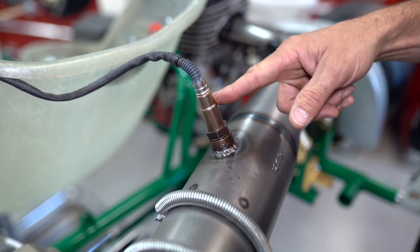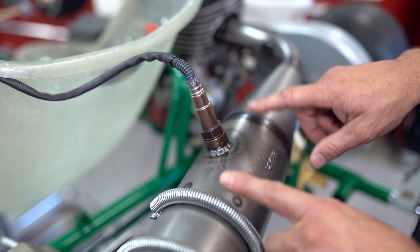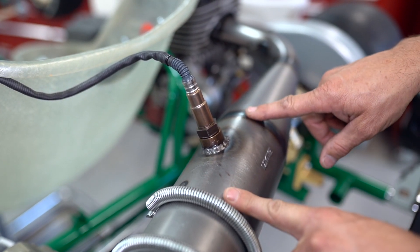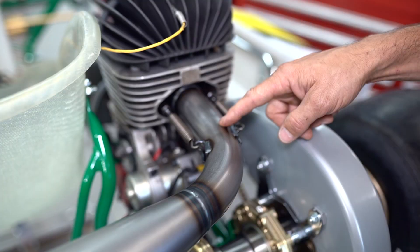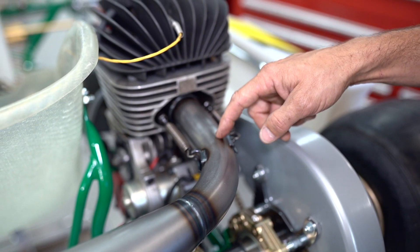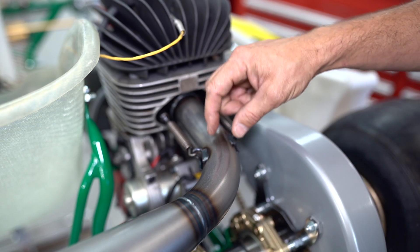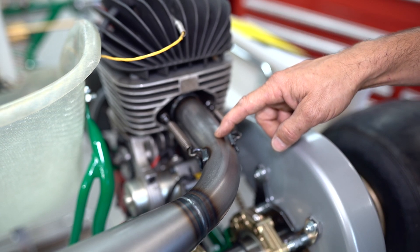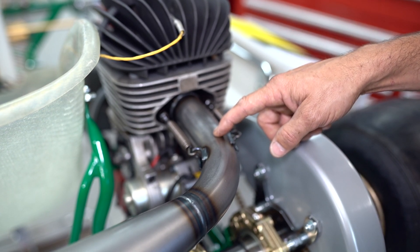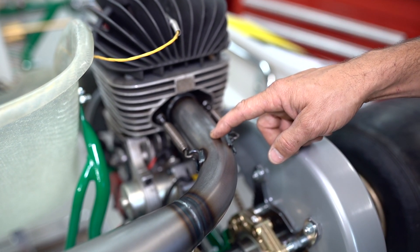You can see this is the Micron LCU-1 lambda sensor — we've got it welded here in the body of the pipe, which is perfectly acceptable because this one has a heated element. But you can actually mount it closer to the engine end too. Same thing: measure about 130 millimeters down from the end of the pipe, drill a hole, and weld on the exhaust socket for the sensor to go into. Either position is fine.